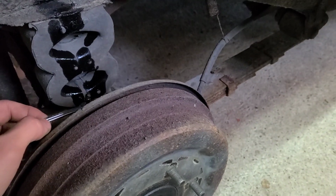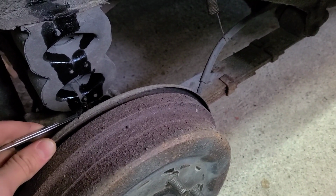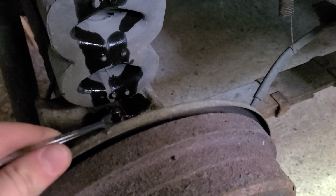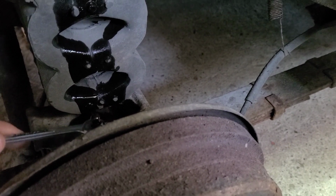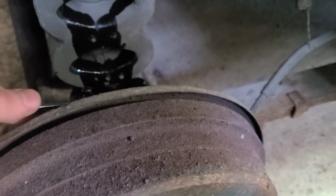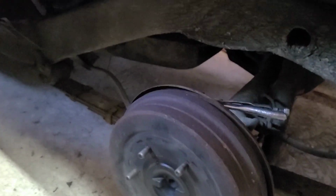Wheel number 2 is off, and we're bleeding it still. Pump. Hold. There. And see, we were just testing to see if there was a blown line or not. There's not, but there's brake fluid everywhere now, so. This wheel is done, now I just have to put the wheel back on and go over to the next one. Just bleed it. Third wheel is off.